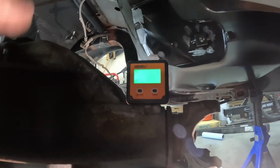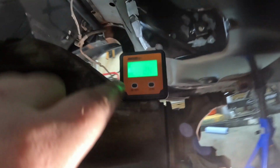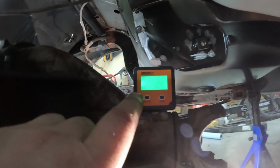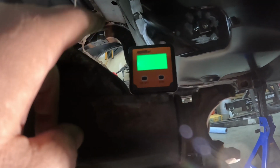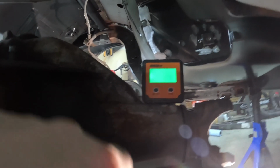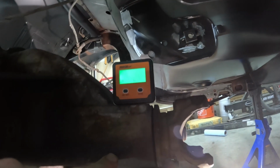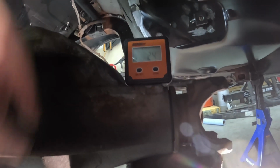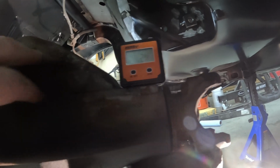All right, I gave the bolts a quick snug on the spring pockets, or spring mounts. I also gave it a very rough angle on the pinion. What I did was zero it out on the car itself, and now the pinion is set to 2.4 degrees down. This pinion angle will get set properly once the transmission and engine are all in there. I just want to give it something now so I know it's roughly in the right location, just something to have it in there for now.